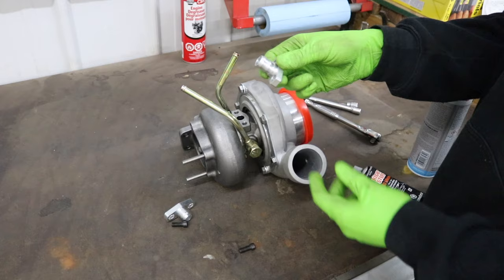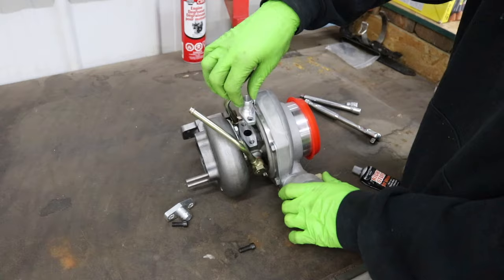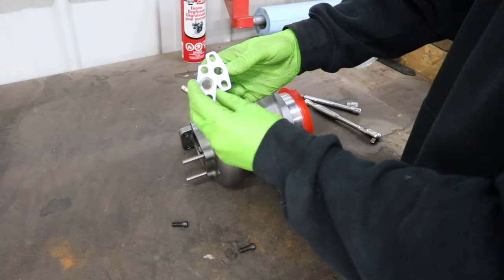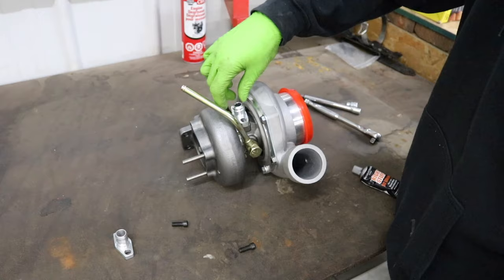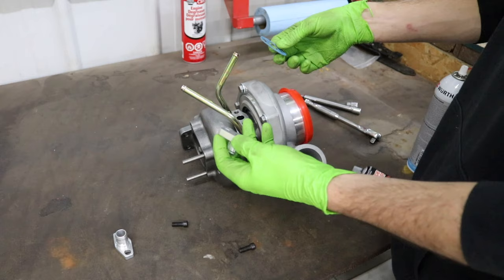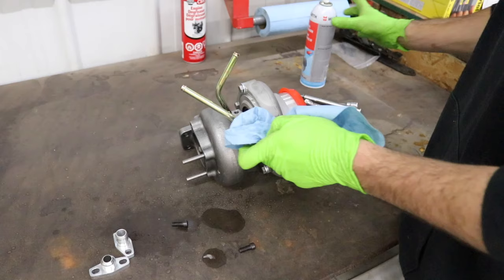The oil drain that comes with the CX Racing kit is just a regular barbed fitting — exact fitment of this oil drain on the turbo, fits up picture perfect. We got a fitting sent out to us by Jack Spania Racing — it's more of a universal fitment. The drain hole is a little smaller and it does fit a little bit loose because it is a universal one — the thread holes are a little bit misaligned. I can't find the oil drain gasket I had with the CX Racing kit, so this is the only one I got. It does not match up very well, so we're going to put a little bit of silicone on it too. First, we're going to clean both flanges with brake clean — make sure they are nice and dry.